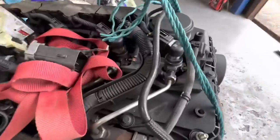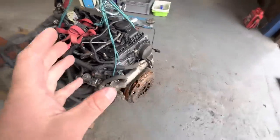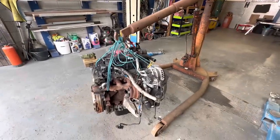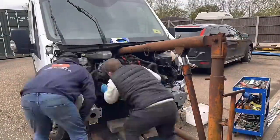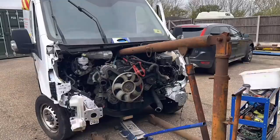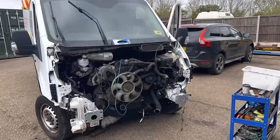Straight back on it — new injector fitted, all plugged in, all the leak-off hoses back on. Everything's plumbed back up. The clutch was brand new, put back on there, all lined up, all ready to go. A little tiny bit of grease around the shaft. Got it roped up on the engine crane — we're going to get it over there and try to get this one back in the hole. Definitely excited, and hopefully it goes in as nice as it came out. Straight in with the engine hoist, just trying to get the spline lined up on the back of the block. It didn't go in first time because I had the van in neutral.